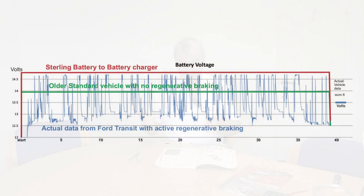We have done tests on a Ford Transit using a data acquisition system and have the actual graphs from the journey to fully monitor what the regen braking is doing. We're going to show a graph of what we recorded on the voltage levels from a trip on the new Euro 6 Ford Transit. The massive voltage fluctuations on the alternator are not a problem from the vehicle's point of view, but they are a massive problem from the secondary charging point of view.